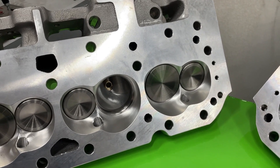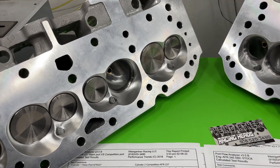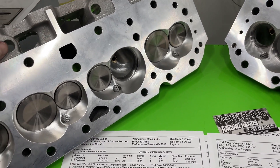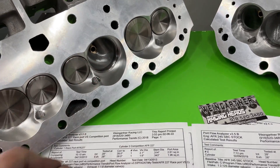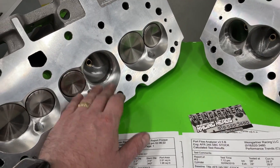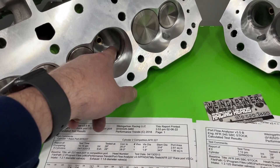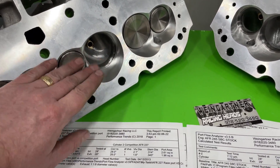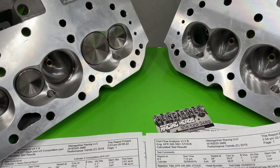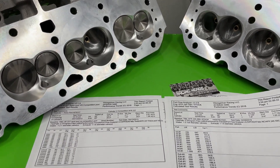If you're looking for an AFR head, the 227 competition port looks really good. However, the 235 and 245 don't flow as much at peak but they'll beat this head because the 235 has a bigger pushrod pinch and bigger intake valve — it's going to make more power. If you compare the competition port to the unmodified race port, the competition port is probably up 20 horsepower. On the AFR 220 where the port design is the same but just smoother finish, I bet there's less than 5 horsepower difference. This one with a different design — I think that's actually worth some power. Thanks for watching.